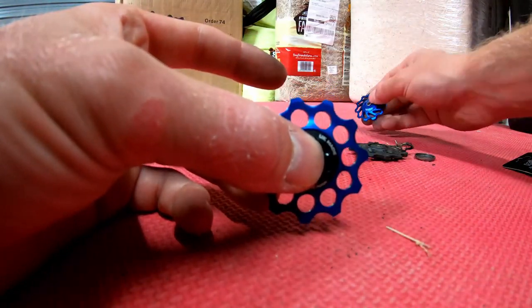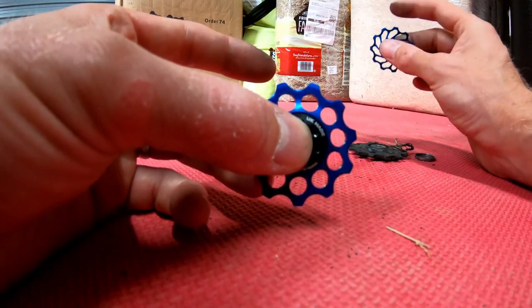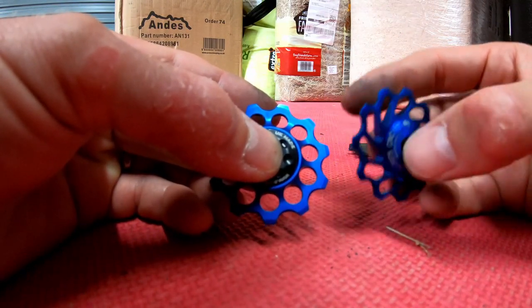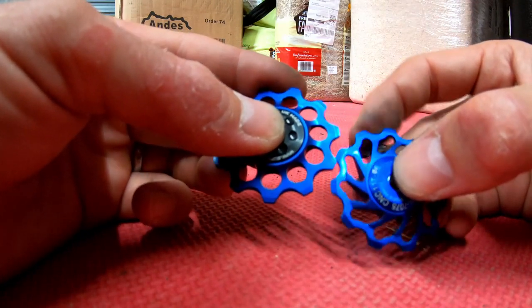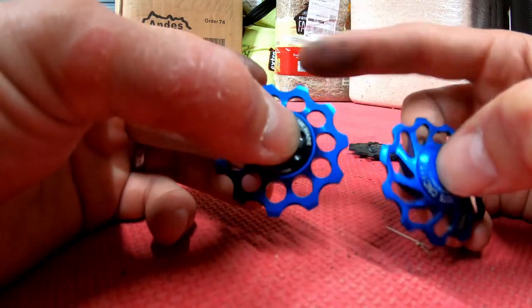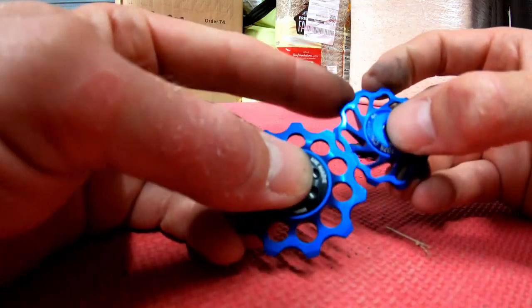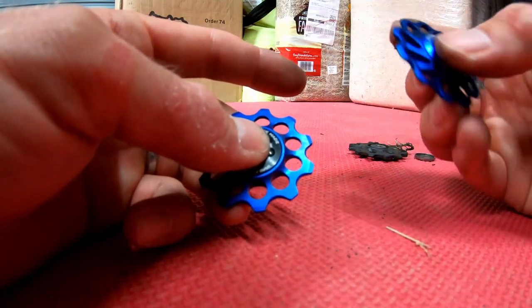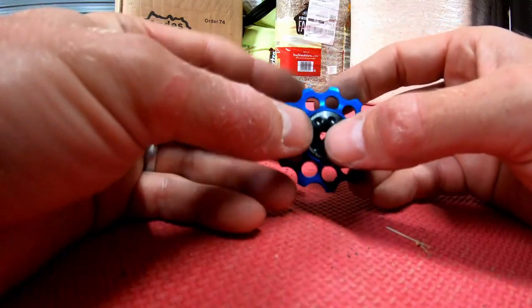And I looked across eBay and they're all very much the same, all manufactured in the same process with this pin system, with these edges. So my advice is, it doesn't matter how shiny or nice it looks, steer clear of it because they're absolute rubbish. Even if you look at the size of the teeth for engaging, they're a lot deeper on a properly made one. So you're not going to get slippage. You're going to get it nice and tight, holding that chain well. Whereas this, after a couple of months or something, will just be slipping. The chain would just be coming out and slipping, and your bike would be unrideable as well. So you'd have to be investing in more anyway. Jockey wheels, stick to known brands that are tried and tested, that know what they're doing.